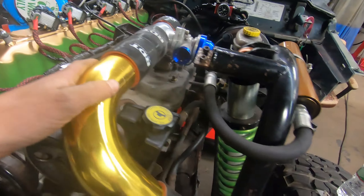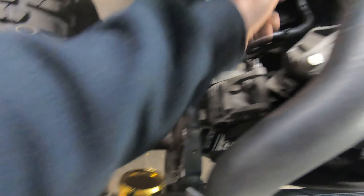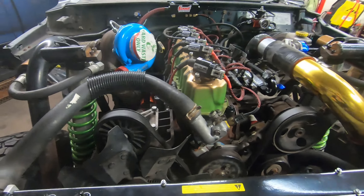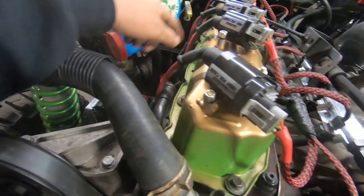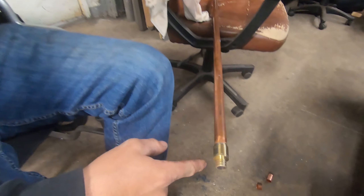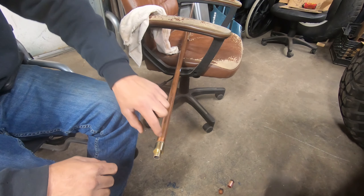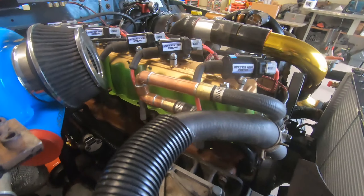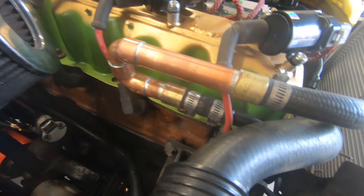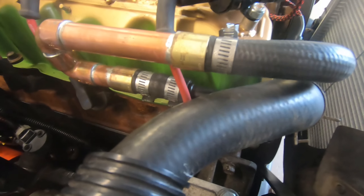We've got one side of our charge pipe on — we still need to put our clamps on. On the other side, we need a couple 45-degree fittings to make the bend, so we'll get back to that. Tomorrow our plan is to make a little U-turn for our heater hose: we're soldering PEX fittings onto copper to adapt to our regular 5/8-inch heater hose with a hose clamp. Here's our mystical heater loop-de-loop — piece of copper, two 90s, a street 90, and a PEX fitting. Simple as that.